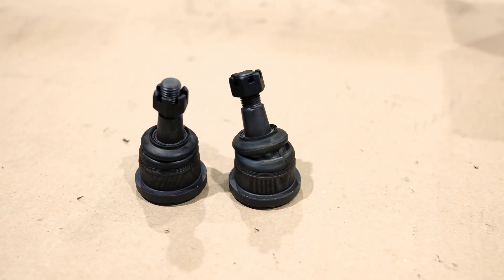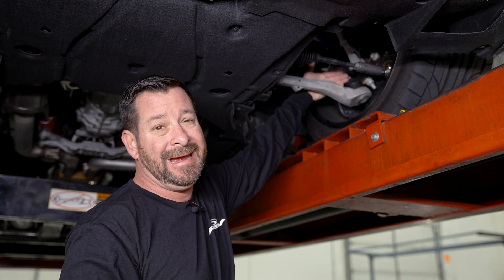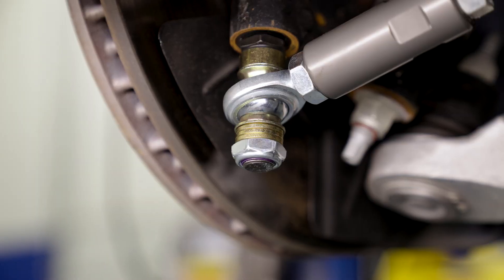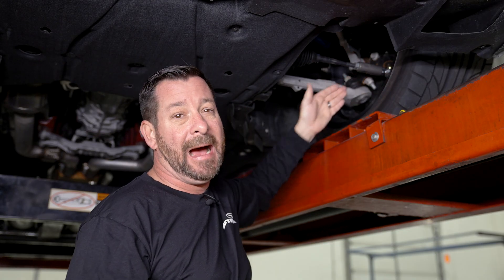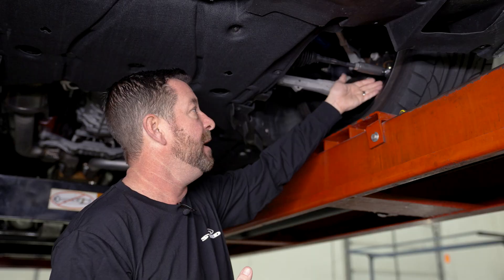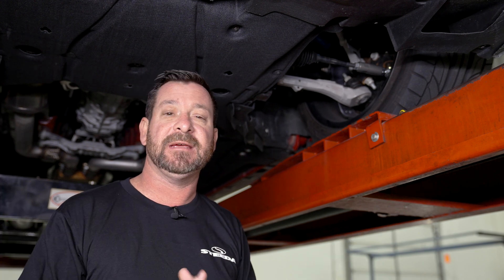One other thing to consider: if you have aftermarket ball joints on your car where the ball joint is extended, it's going to have the arm at a different angle, meaning you're not going to have as many spacers in the bottom of the bump steer kit — those are going to go to the top. It's important to use all the spacers as long as you've got the thread showing through that nylon bottom lock nut. As you can see, it's nice and parallel. We already did the one-inch compression and this seems to have it where there's the least amount of toe change.